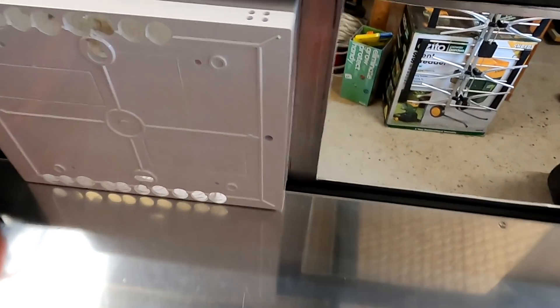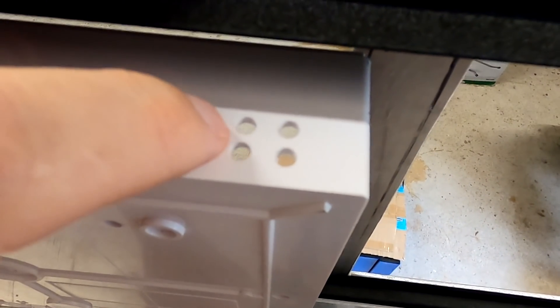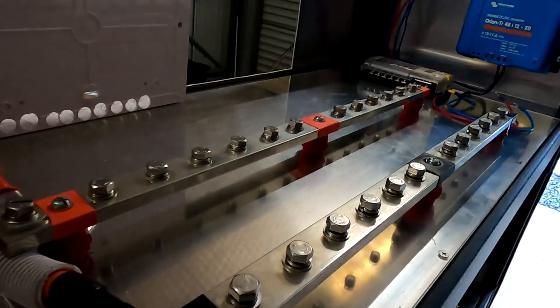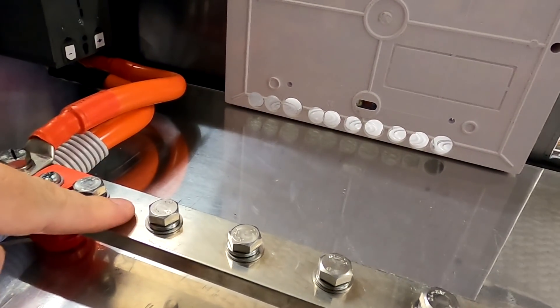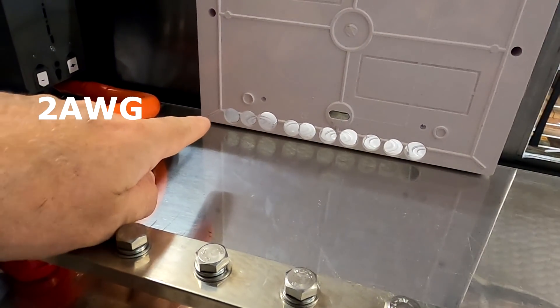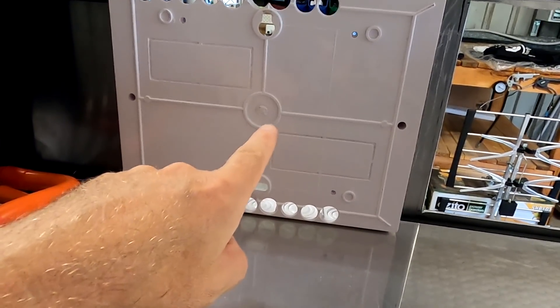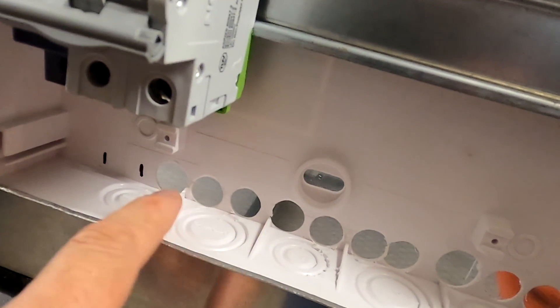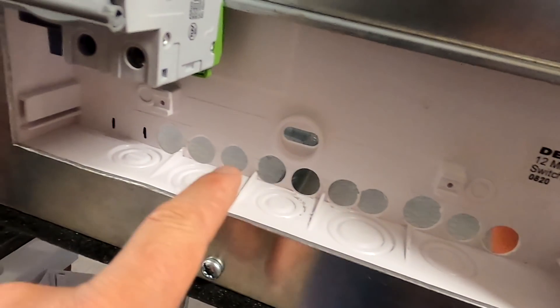I have drilled four holes into the switchboard on the top — two are for the 48-volt supply going to our DC converter, and the other two are our 5-volt output going out the back side of the switchboard and then all the way to the wireless bridge. I will also do all the cables from the bus bar to the circuit breakers in 35 millimeters, so that if I need to change anything in the switchboard — like replacing a circuit breaker from 10-amp to 25-amp — I can still use the incoming cables. So all these ones will be 35 millimeters.